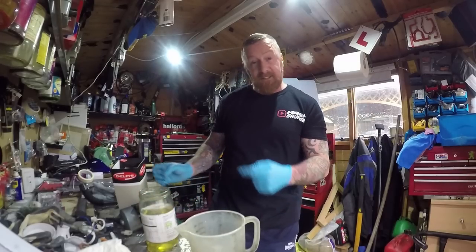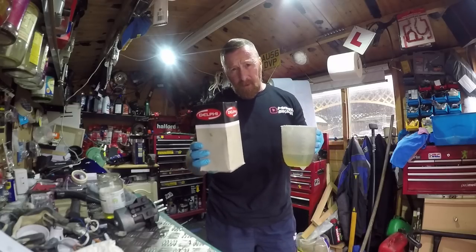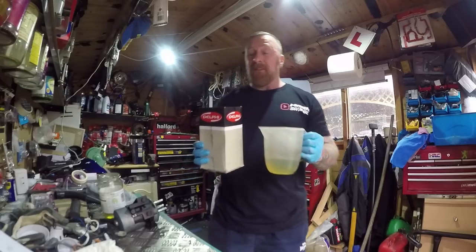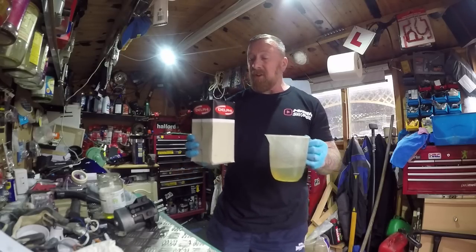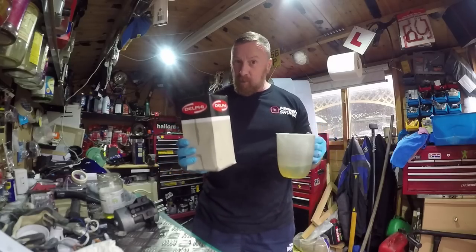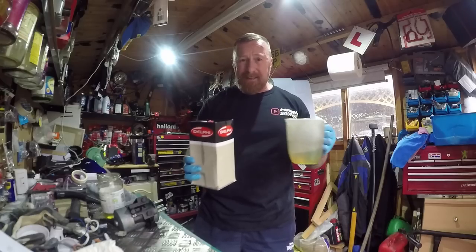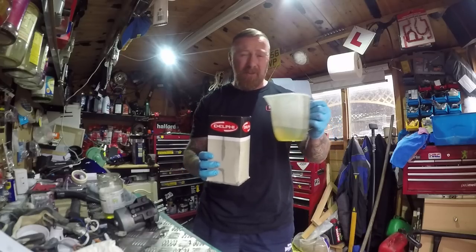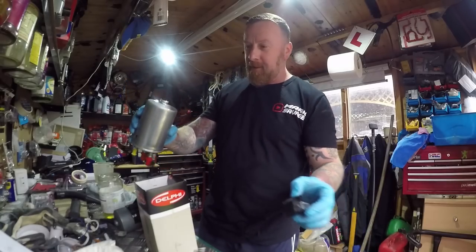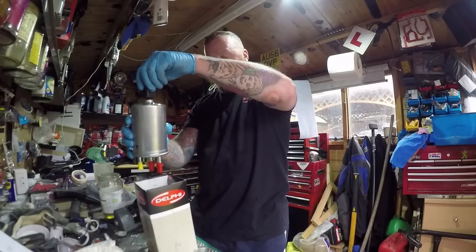You may wonder why we pre-fill it. If you just put this straight in the car and turn it over, the car will stall — it won't run. There's no way of pumping on newer vehicles, so you'd just be turning over and putting air in the system, and you'd have to call out a mechanic. This is why you pre-fill. With petrol cars it's not the same, but certainly with all diesels, no matter the age — if you've got a pump, prime it.